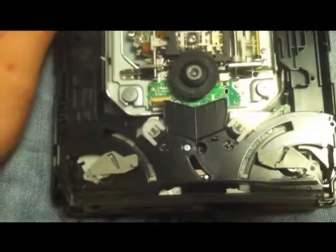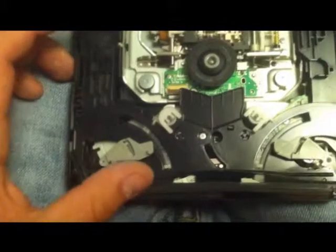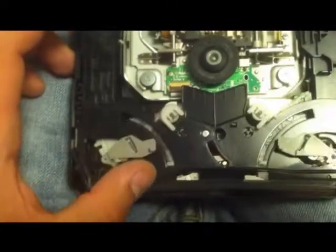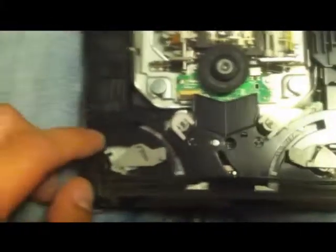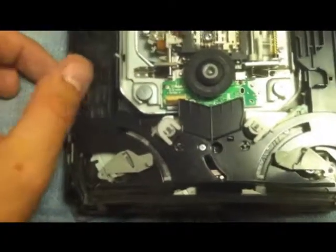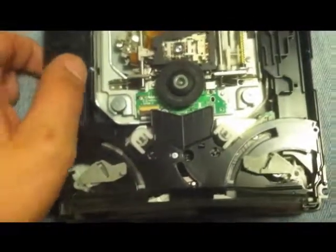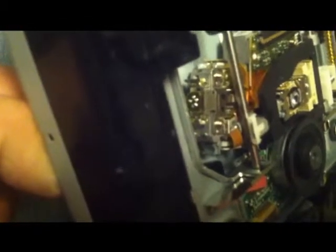So that's it for this video. It's pretty easy to put back together — put this top cover back on, then the five screws that hold the top case in, and then the other five on the bottom. I hope this helps you guys. Again: five solder points on the side — bottom is ground, left is PS2/DVD, right is Blu-ray for PS3 games. Thanks for watching and subscribe.